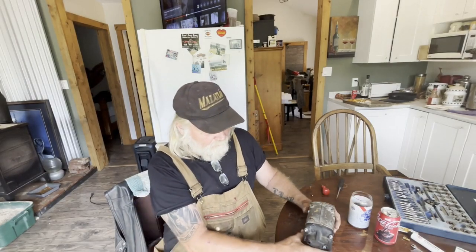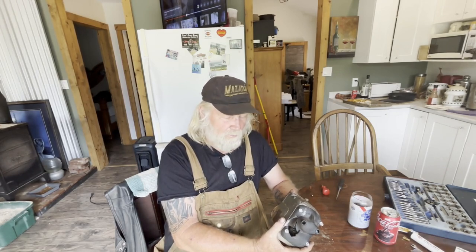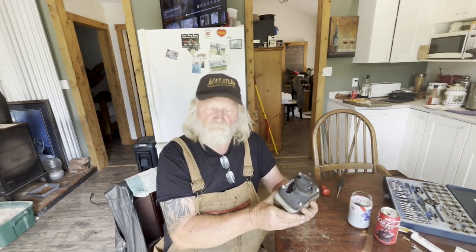Okay, that's going to be it for this video. We got what we wanted accomplished. I got into this mag at this end of it anyway, where the points are, all the working parts, and cleaned things up and got our cap kind of glued together. Found some brand new chrome screws there to replace the two rusted ones, and we just made it work. I think you can see on that video I had the lead to the body and I was turning the impulse. We had a hot spark. So that to me is a pretty darn good success. We're ready to put this on the old 20 motor there on the Autopatrol 11 when we get to that point where we're going to try to start the pony.